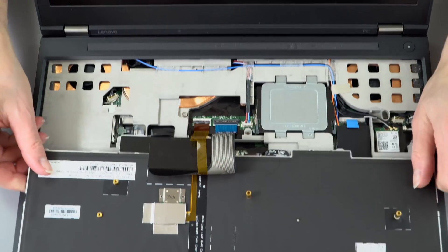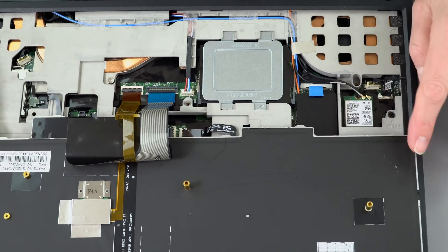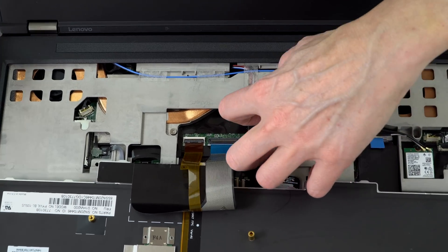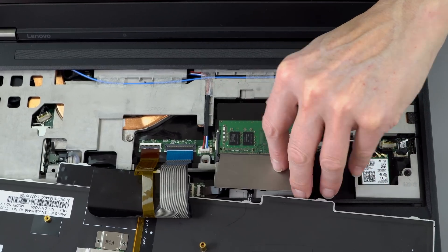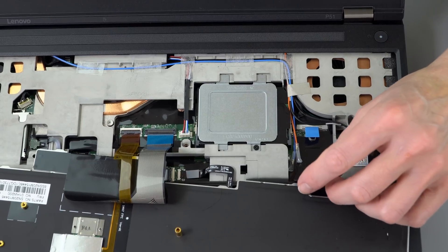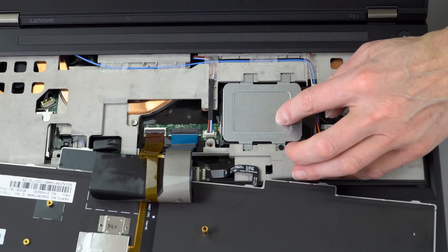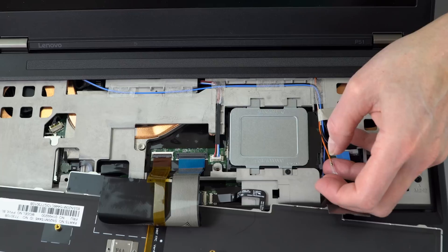It's pretty easy to get out, and the build quality is very solid and well done. The Wi-Fi card is accessible from this side without removing the entire bottom cover. You can see the copper cooling pipes and two fans. Under a small cover you'll find the other two RAM slots with robust covers. There's also another M.2 slot for an optional LTE WWAN module. Previously older P-Series models had interference issues with LTE, but that has been resolved. The wires for that module are already in place.